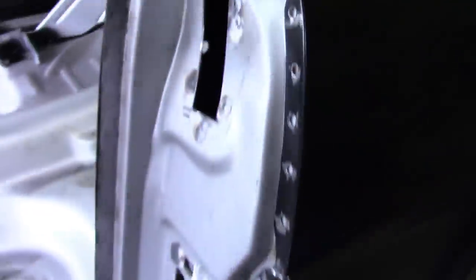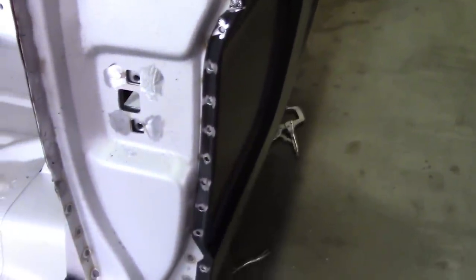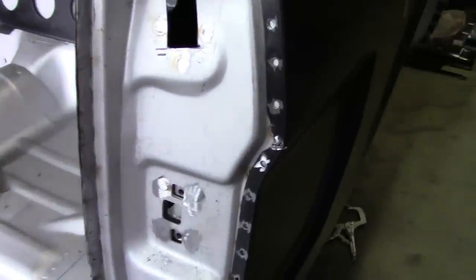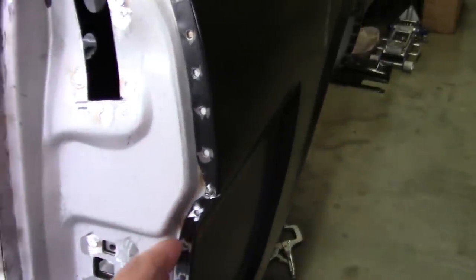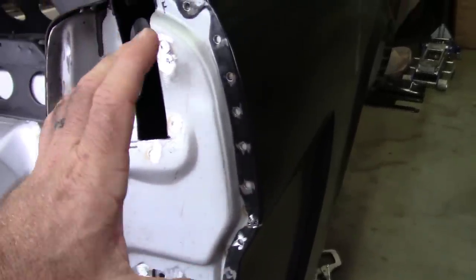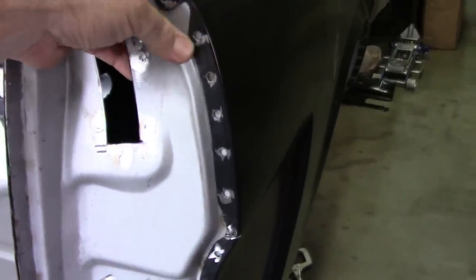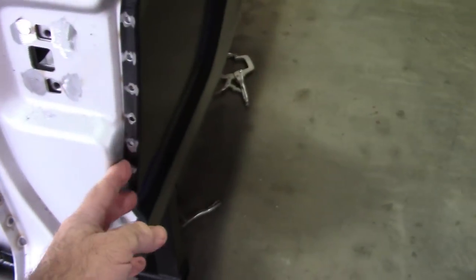Now I'm going to point out some things. Whenever I do these, of course I'm going to put the tail panel on, clamp it in place before I do anything else. But when I do these and I weld them together, I'm not going to weld the whole thing right now. What I mean by that is I'm not going to weld the front edge of the quarter panel, because when the fitment of the door comes into play, I don't want to have this in a fixed location and then I can't move it to match the door, or if I need to just give it a little bit of a nudge one way or the other, because you can move this around a little bit and change the alignment. So I'm not going to weld that yet,